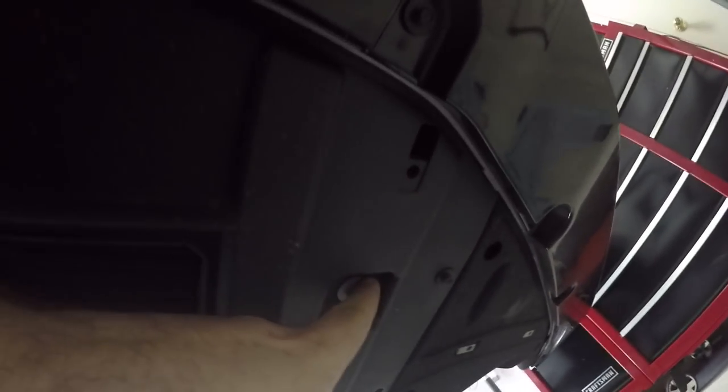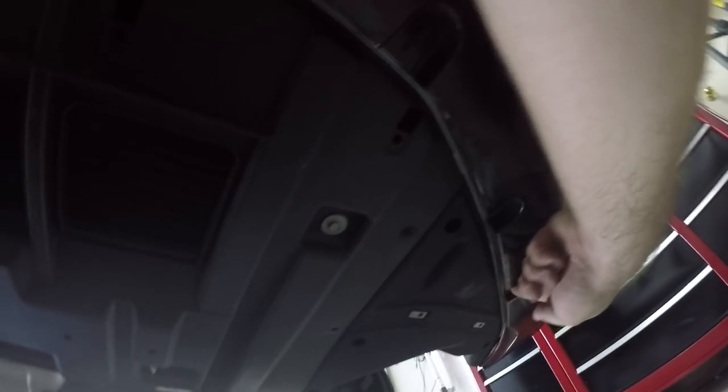So underneath here, there's a bolt here. There's a couple bolts under here, couple bolts there, one there. But then there's 1, 2, 3, 4. Looks like there's a total of 9 bolts to remove underneath, to where this whole piece should drop down, I'm guessing, this whole piece here. And then I think we'll have to undo these no matter what. So 4 on the splitter on each side, and then the ones underneath. Yeah, let's see how this goes.